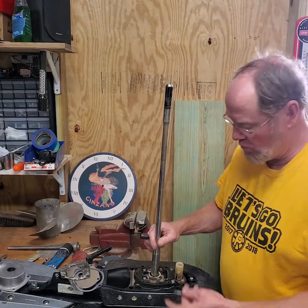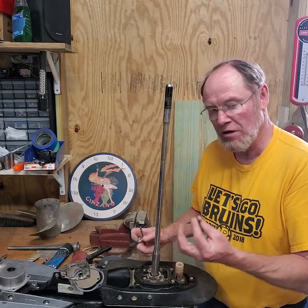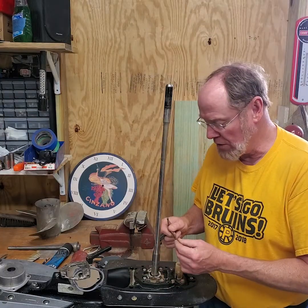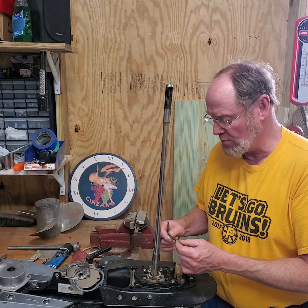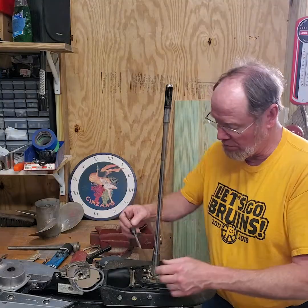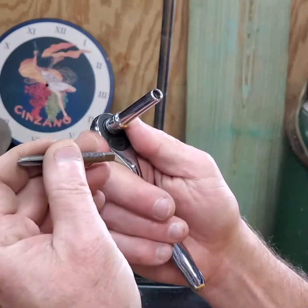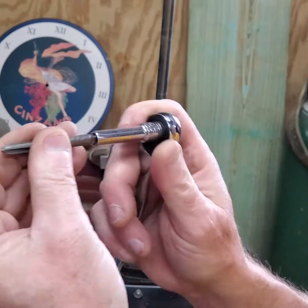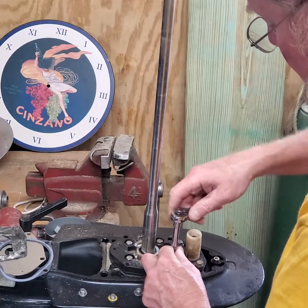While I'm draining the gear lube, I'm gonna get this pump ready. These bolts came out pretty hard, so we're gonna tap those holes out. The tap you need for these bolts is a 6 millimeter by 1.0 millimeters per thread. Here's a 6 millimeter tap, and here is a 6 millimeter socket which fits it really nicely. I'm just gonna run these down.